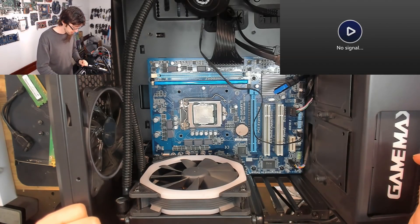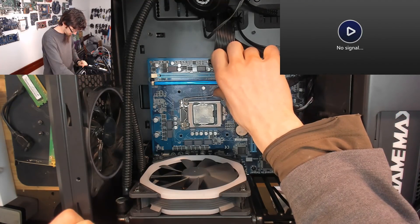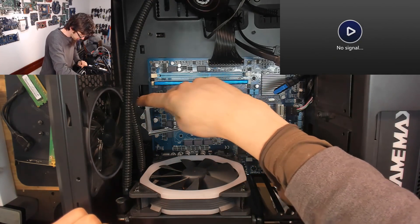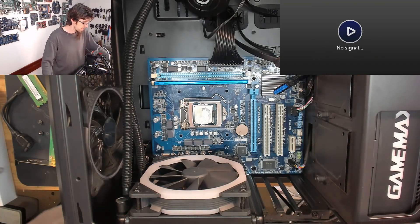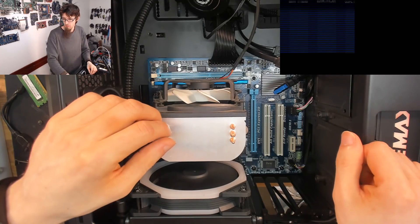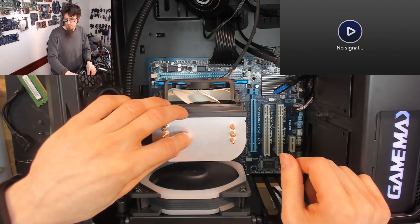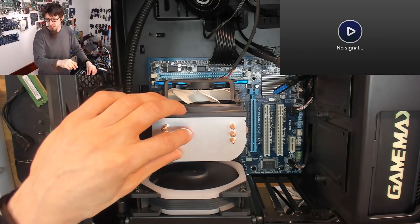Should we be checking the power supply at this point? I've jumped straight to CPU but I really should have plugged in a different power supply by now. I'm going to try a different CPU super quick — I have a spare literally in arm's reach. This is an i3-3220, which is also compatible — it's the original chip that was in this motherboard. Power on. Okay, there's some display output but it power cycled again. It's been trying to put something out on screen — just some weird lines in the top left. I think this is a motherboard issue at the moment.